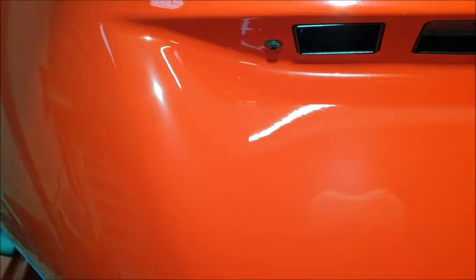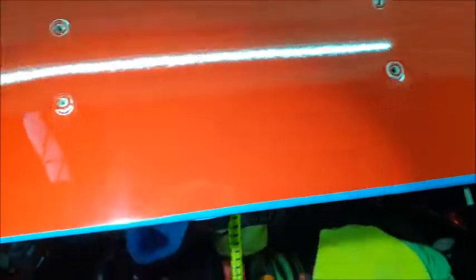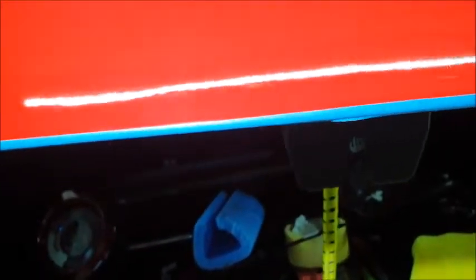This part was really bad around the number plate, and this has had 2 cuts and is ready for some refinement, although again there's some deeper scratches along the bottom edge of that, which I could do with flatting more as well. And that's before we get to the rest of the top of the boot lid. So that's where I'm up to.